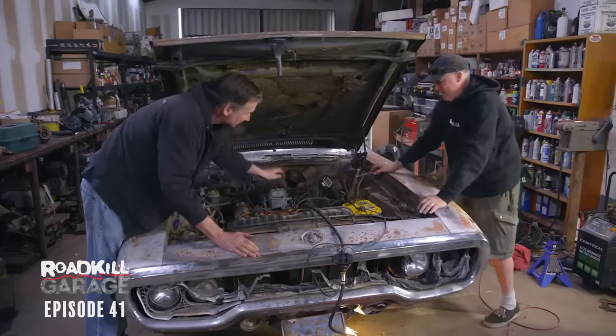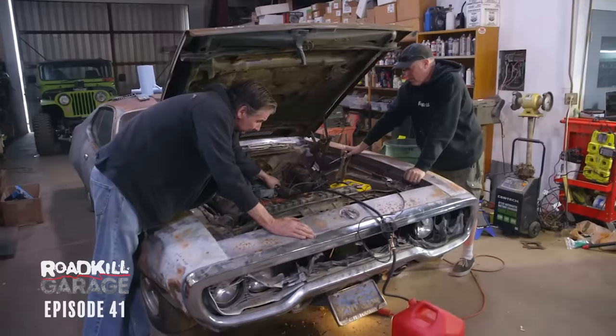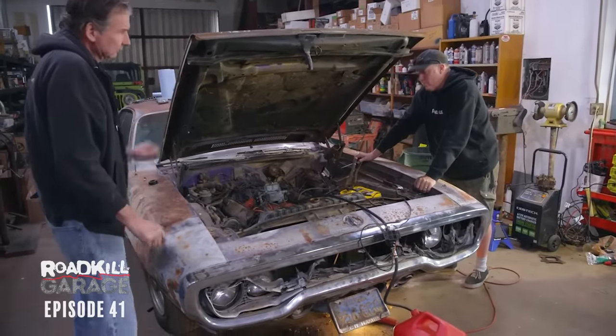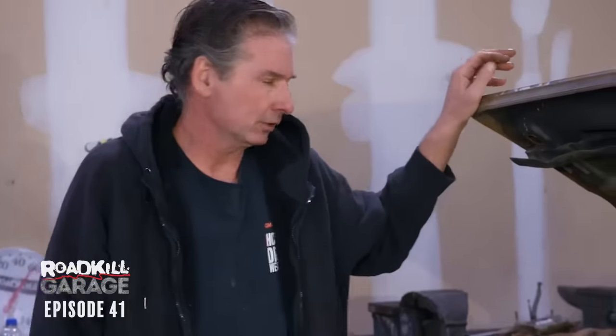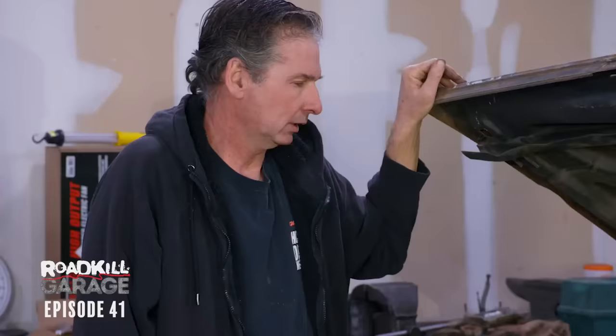Come on, oil pressure. How come it's not getting oil pressure? Didn't you hear the lifters? I heard that, but I'm wondering maybe they might just be a little sticky. It could be. I was thinking ATF — pouring in a little bit of automatic transmission fluid, which tends to have some cleansers that will keep the lifters from clacking, or at least break them loose if they're varnished or rusted up.